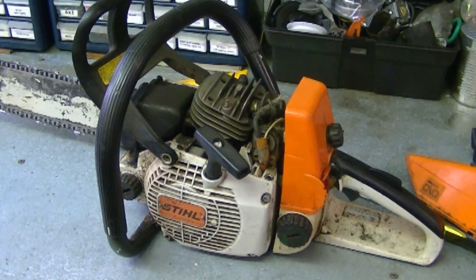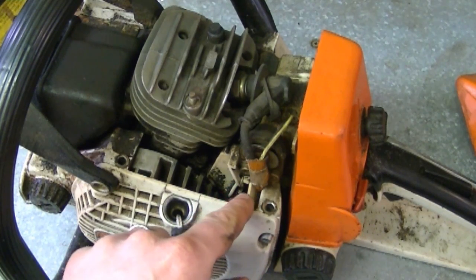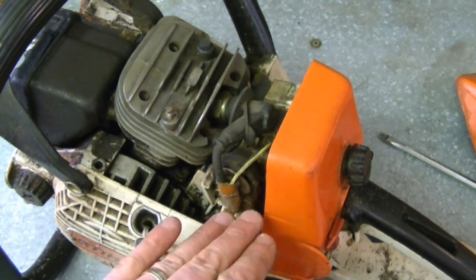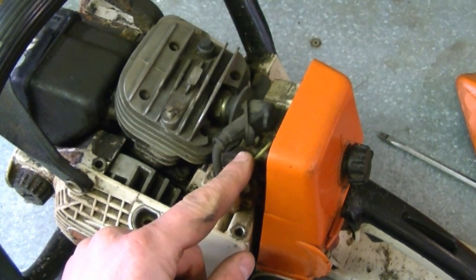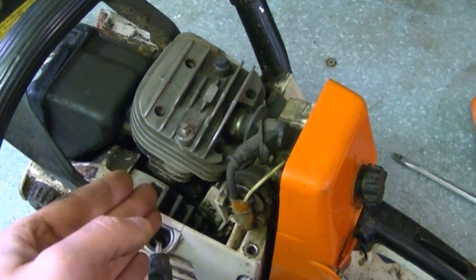A YouTuber asked about a concrete saw with no spark. Usually it ends up being the ignition coil — same idea with a chainsaw, it's the same principle with a two-cycle motor that only has an ignition module for spark. But before you spend a lot of money replacing the ignition module, check the small wire that goes to the coil and the ignition switch. It could be an electrical issue like a wire that's shorting, or the gap between the coil and flywheel isn't proper. Make sure to check all the wires first. You can also disconnect the small switch wire from the ignition module and try it — that bypasses the switch. Be careful because you'll have no shut-off switch. If you disconnect the switch wire and have spark, then you know it's an electrical problem, which can be harder to find but much cheaper to repair.